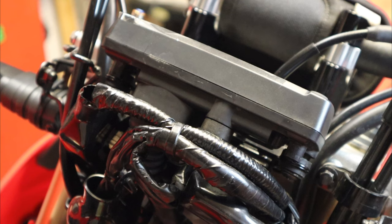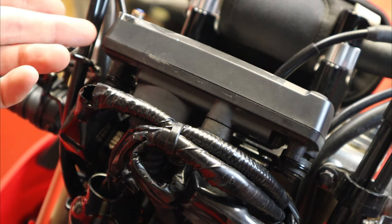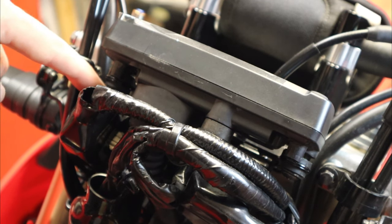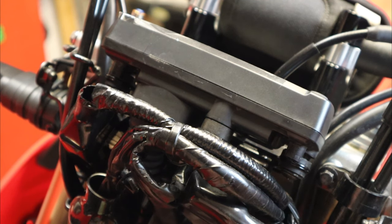What you're seeing here is behind the headlight — this is the wiring harness on the backside of the dashboard. The dashboard is connected with three screws that you need to remove: there's going to be one right here, one under here, and one right here. You're going to take care of that with your screwdriver.